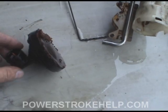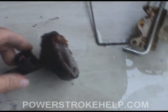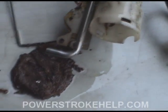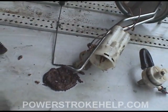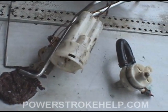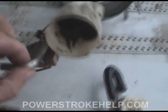This is the pickup that came out of a truck that has been running biofuel. Look at that stuff — it looks like freaking jello. It's nasty. The truck — we've had to clean the whole fuel system. The fuel pump is bad. The injectors are messing up because there's no fuel flow because of the crud in the tank.